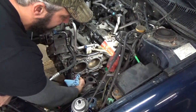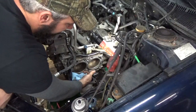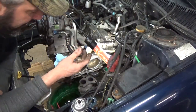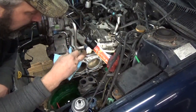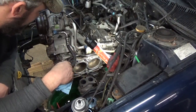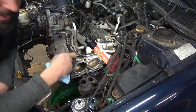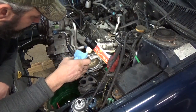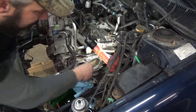The oil returns here just drop back down into the oil pan. What I'll usually do is hose these down with some brake parts cleaner to flush any debris or sediment that was sitting there down into the oil pan. It'll cling to the oil, and we're going to pull the drain plug and let this thing drain a good 24 hours or so, and any sediment is all going to come down and out with the oil. Anything really light and small, micron size, is going to be picked up by the filter anyway, so I'm not too awfully worried about it.